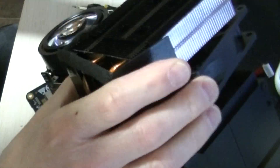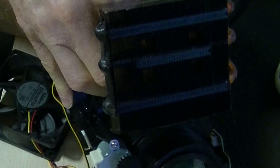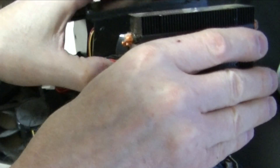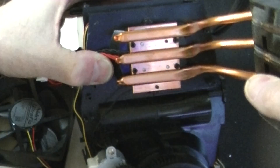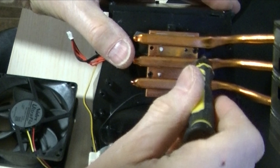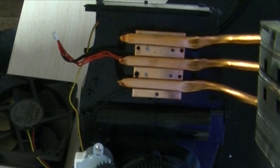For the next while I looked for transverse running screws to remove to separate the case halves. This allowed me to liberate the fan and access the light emitter by bending back the heat sink connected to the heat pipes. It's probably not a good idea to do this, but at this point I don't think this projector will ever be used again. Next I removed the screws attaching the copper heat sink from the plastic housing so I could get a good close look at the LED.